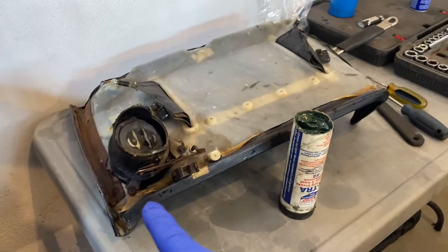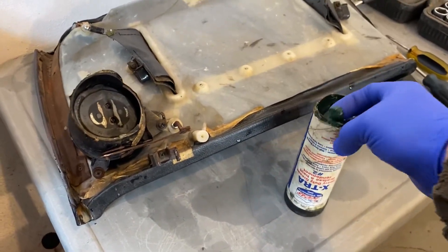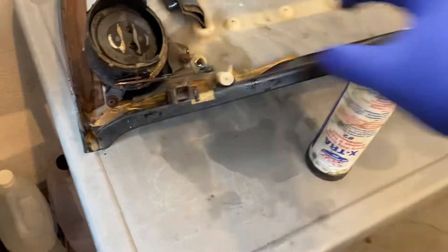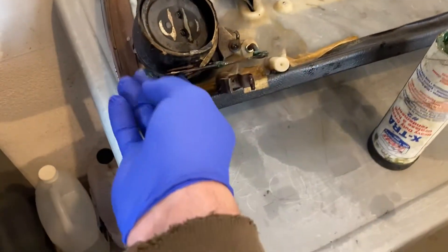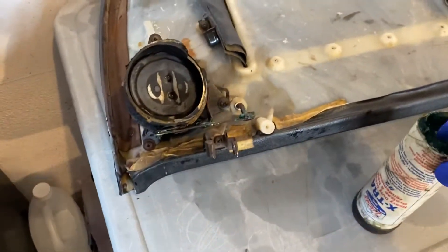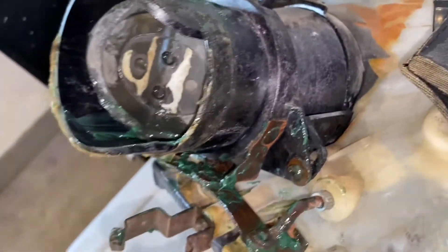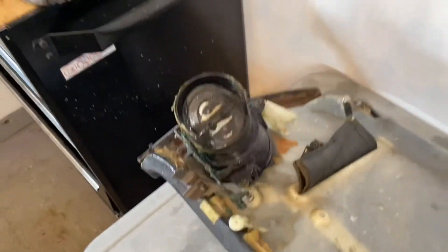So we're inside. This is the passenger side one, the one that wasn't cracked. We're taking some bearing grease — like just like you would do bearings on a car — putting some on our finger and basically squeezing that into all the moving parts, just like you're greasing up a bearing. We're going to do all that to every single part. It's on the inside so you're never going to see it. Plus, this will prevent mice and will prevent this from ever rusting again. There it is all greased up — that's what it should look like. Everything's greased up, no chance of it rusting again. It moves so good now, doing everything it's supposed to be doing. So this vent is 100% fixed. That's how you fix it if it wasn't cracked.